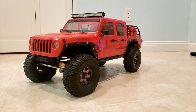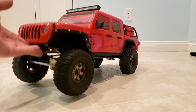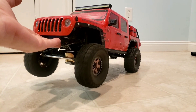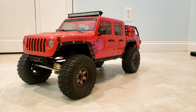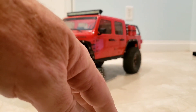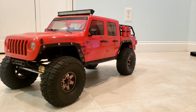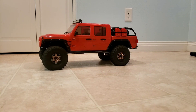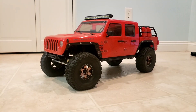I also have a DIG set up on this, configured so that I can put it in front-wheel drive only. That way if it drops straight into a V and you've got to come back up, it won't bind the suspension or drivetrain by having the back wheels push the front in while the front hasn't even climbed yet — it'll keep from binding up the drivetrain. It also has full DIG, same as the Capra. I've discovered that on longer wheelbase cars and trucks the DIG is not as effective as on a shorter wheelbase, but it still works.